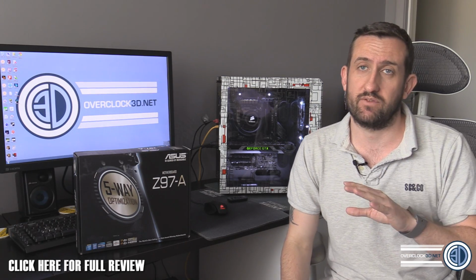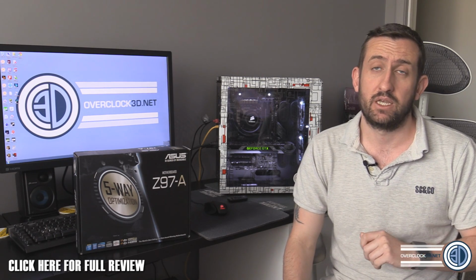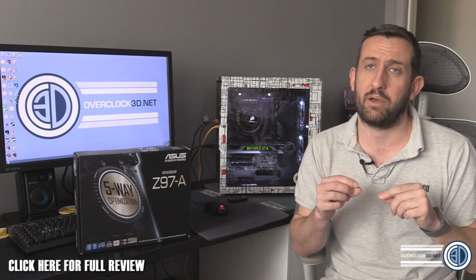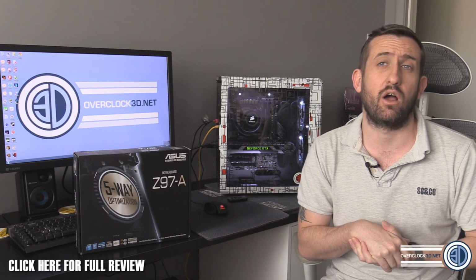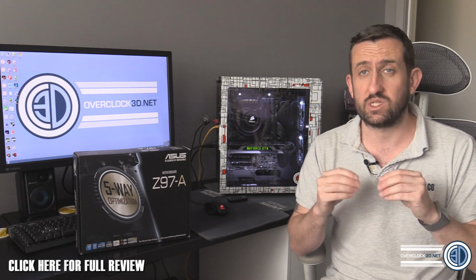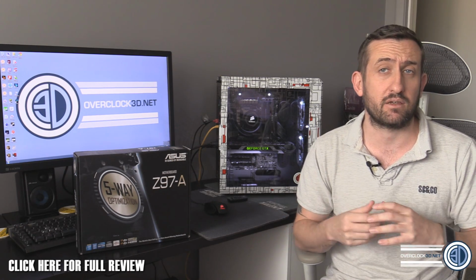Now, the real biggest change, and it doesn't really count with the 4770K, but the main changes for Z97 were that Intel realised that they were having heat problems with Haswell. I'm not 100% sure why. I didn't particularly pick it up on Ivy Bridge, but we knew about the thermal paste issue. Now with Devil's Canyon, that should be fixed. Intel are saying they have spent a lot of time working on that. So fingers crossed. But another thing that they've done, which hasn't particularly been shouted about very loudly, is that on Haswell they did put the voltage controller for the CPU onto the CPU, and there was a lot of speculation that that could have been where a lot of the heat was coming from.